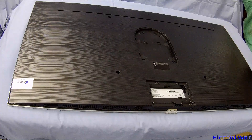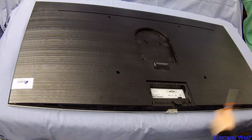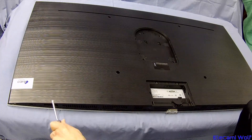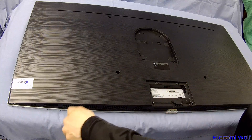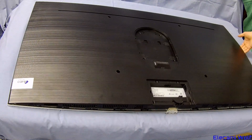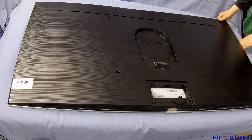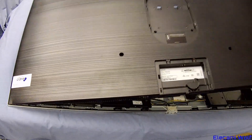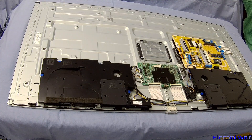The method for getting these things open is there's a small hole in the corner and in the other corner, and you get your delicate tool, shove it in there and yoink it upwards enough so that you can get your hand in there and then start pulling up to release the clips, then work it around to the top like that. Makes a lot of noise and it's very difficult. Then you lift that off. We just snapped off the bottom corner.